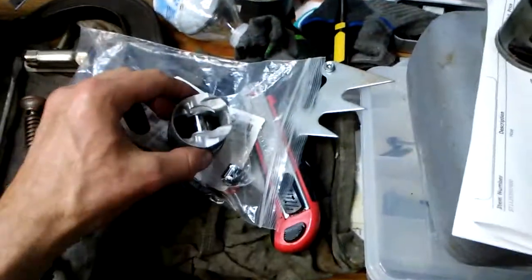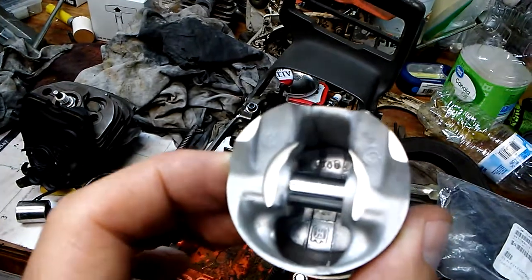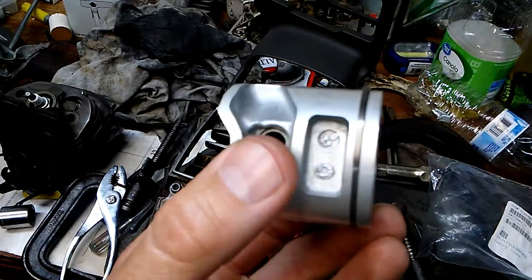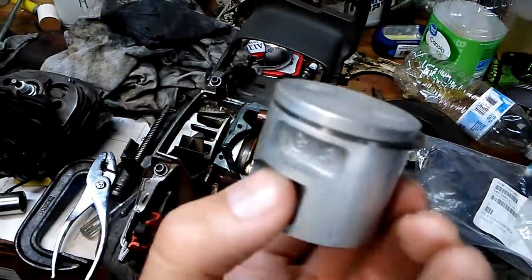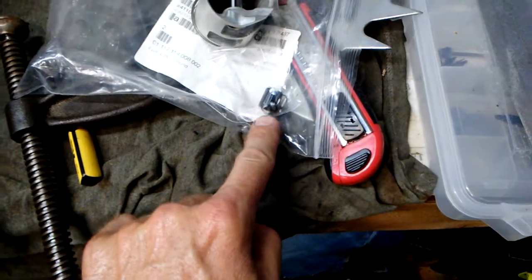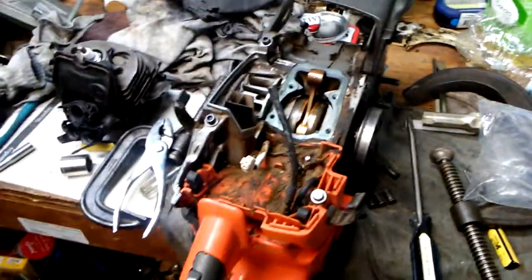But anyway, taking everything apart, cleaning everything up, going back with Husqvarna OEM. Here's the casting mark in the bottom. Compared these numbers, and they are from different castings, different molds, these pistons are. But going back with OEM Husqvarna piston, ring, clips, pin bearing. And top end's going on next. Thank you for watching.